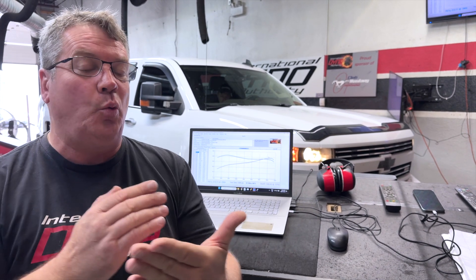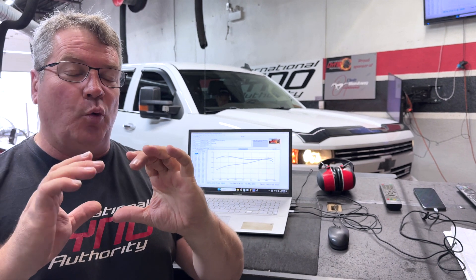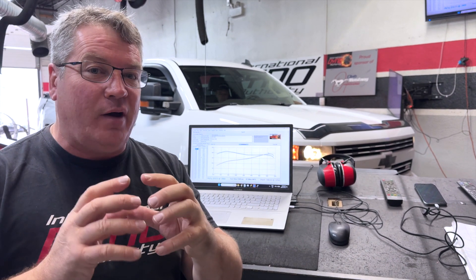We're going to give him a whole lot more power in the area where he can actually use it, which will also improve fuel mileage. You'll have a lot more power at the beginning of the pedal because we're going to make the engine way more efficient down low — not by raising the timing, but by working with the fueling. Once the fueling is correct down low, we can work with the cam and make the engine rev up in the lower RPM range at a much more aggressive rate. You barely have to step on the gas and the truck gets going. That increases fuel mileage because most fuel is used on takeoff or acceleration — once you're cruising, there's really not a lot to be gained.